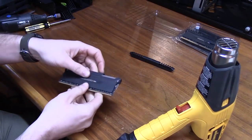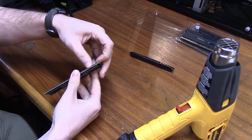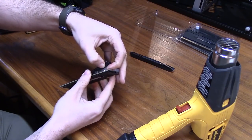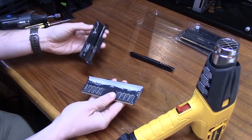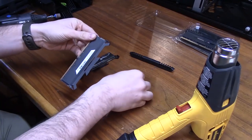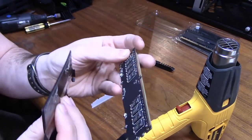If you have a blow dryer laying around, you could use that, or if you don't, I'll leave a link in the description to this heat gun that I'm using. It's pretty cheap, or you could just go to a local hardware store and pick one up for equally as cheap. Basically, you just heat up the RAM stick until you can pry off those heat sinks with just your fingers. And don't worry about the heat damaging anything. RAM is super heat resistant, so you're not going to hurt anything with your heat gun.